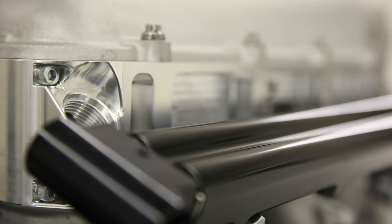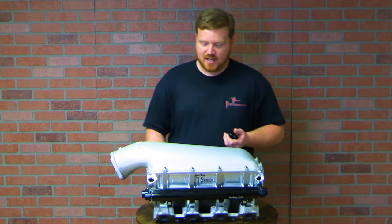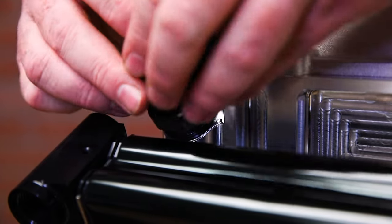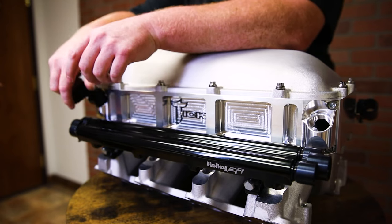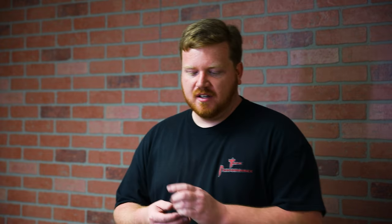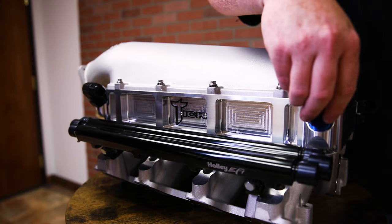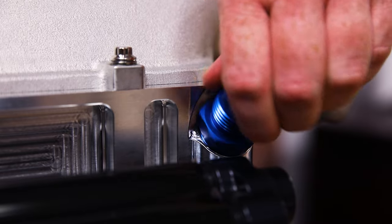The fittings are on about a 40 or 45 degree angle, which points them up and away from the fuel rail. You can run a 90-degree O-ring fitting that threads right in and O-ring seals, giving you the ability to tuck a nice coolant line right beside the fuel rail — it'll look clean and flow right with it. You can still do a straight ORB fitting if you want, though it'll sit a little higher.